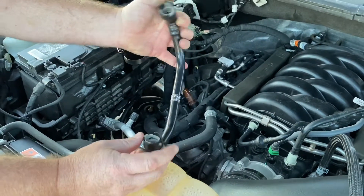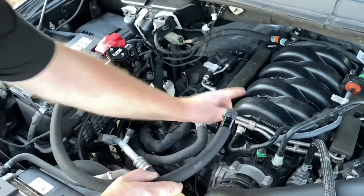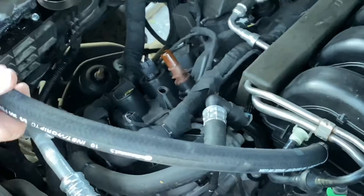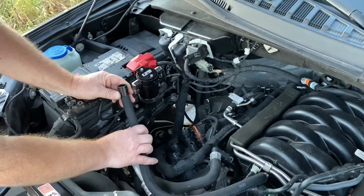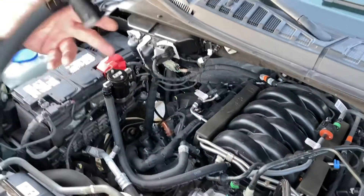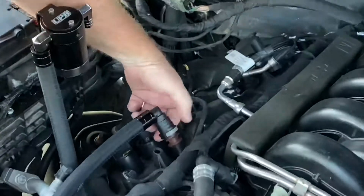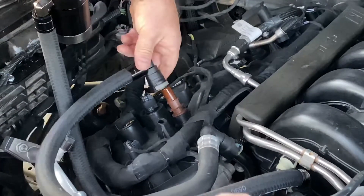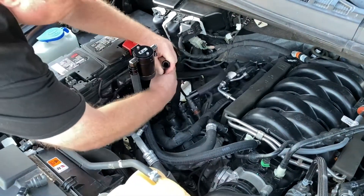Your vacuum hose is a 45-degree hose that just clicks on. You're going to put your UPR billet hose and ferrule on there, and that's going to go to the forward fitting on the catch can — it simply pushes on. Your PCV hose is the 90-degree fitting — click that on. All the UPR plug-and-play fittings are similar to the OEM, only easier; just push the button, pull them off, click them on. This one is going to route to the rear fitting and simply push on.